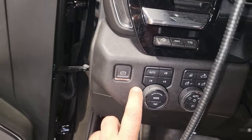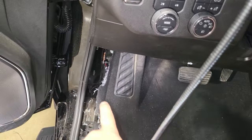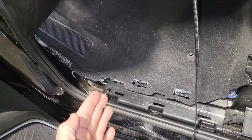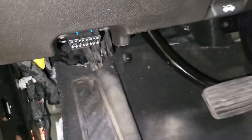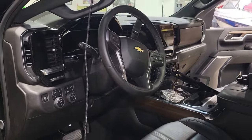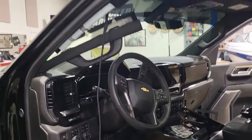You don't need factory switches but they're nice. Otherwise you might want to put a three-quarter flush mount switch right here. Either way, this wire will come down and over to here. Right down here we've removed this kick panel, which is fairly easy. We simply pop the trim off the side of the seat by pulling it straight up after raising the seat all the way up. The trim panel lifts up and pulls straight backwards to be removed because there's a ground stud right there — that's your ground. You can get a nice earth ground right there, and your factory auxiliary switches will be tucked up underneath there. If you want to use an aftermarket switch, there's a fuse box right here with plenty of power so you can power all this from inside the cab.